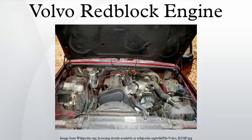1989 saw an upgrade to the crankshaft, with a relocated axial thrust bearing back to the number 5 journal, bigger main bearings, and rods enlarged to 13 mm from 9 mm in 1990. Also introduced in 1989 were 16-valve twin-cam variants of the B200 and B230, dubbed the B204 and B234 respectively.